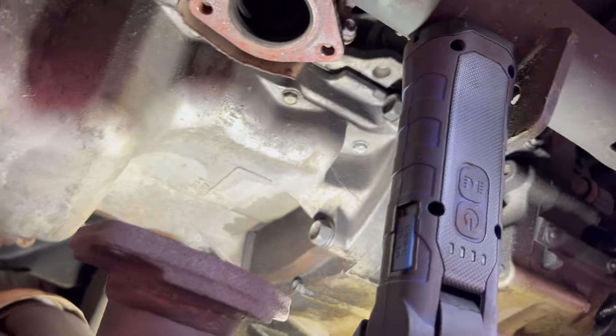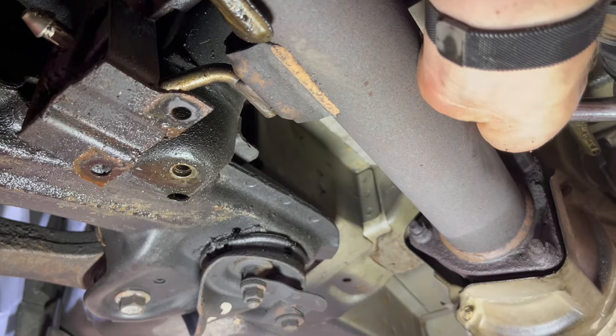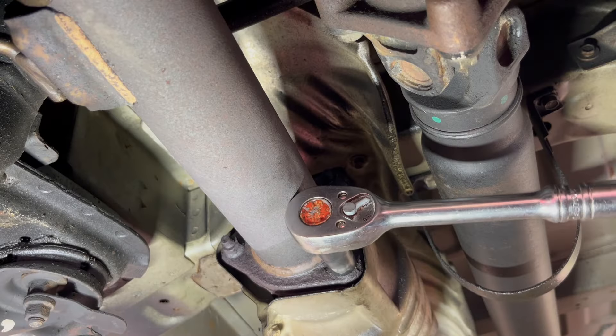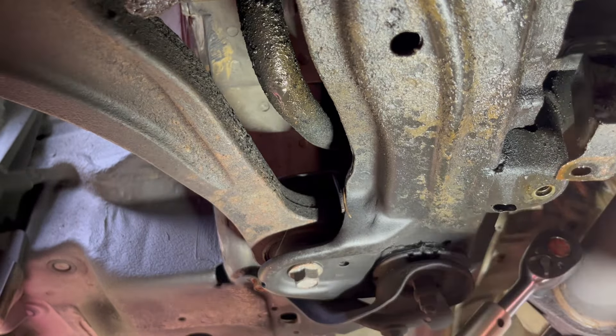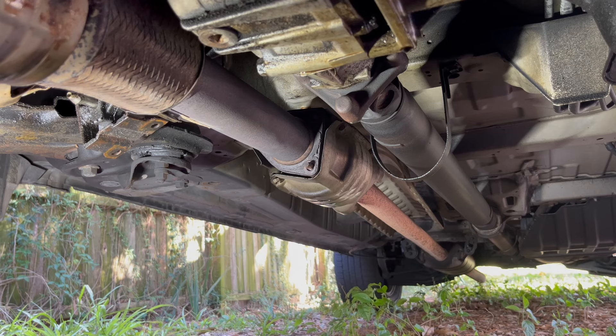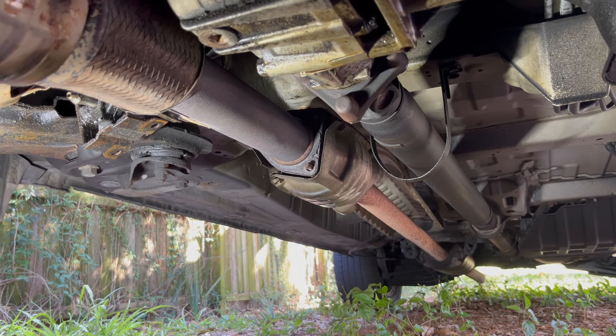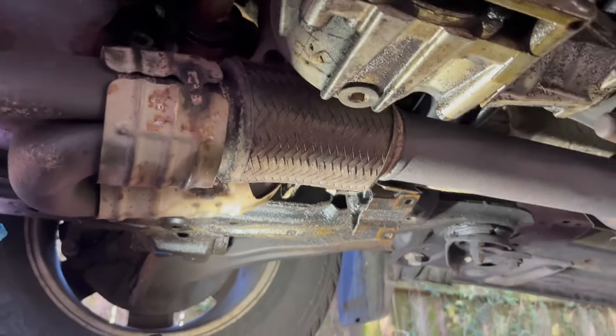So this job clearly can be done with the exhaust in place, but the exhaust gets in the way for the video. I'm gonna try to remove those three bolts in the back. Those came out — this one's turning too. I removed all three of those nuts successfully, not on camera, but just kept using the extractor socket and all of them came off. Threads look okay, nuts not so much, but I'm replacing all of them anyway. So now I'm gonna remove two nuts I put in temporarily, and then I should be able to remove the exhaust.